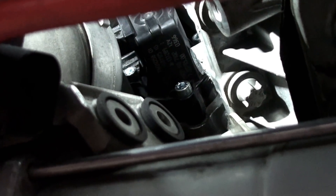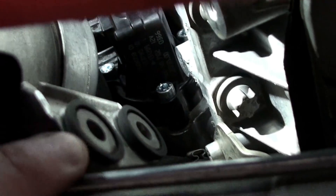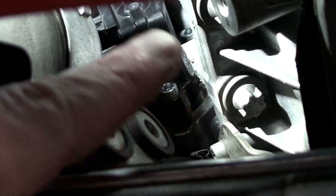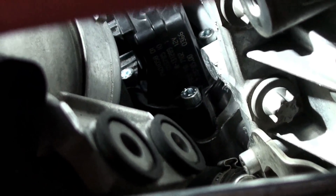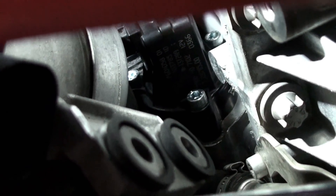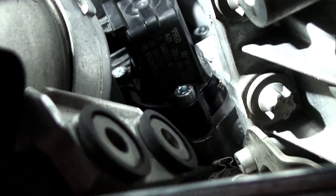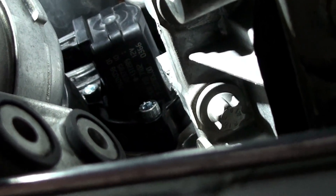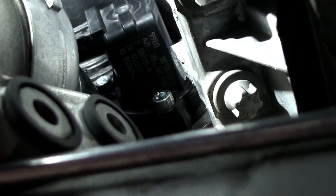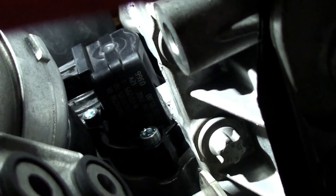The diverter valve is in. It definitely went in much easier with the right tools than the other one came out — reassembly was a lot easier. The water pump is currently sitting out of place; you can see it here and this is where it would mount to its mounting plate. We also removed the mounting plate to give more room to maneuver in that space. So we pulled three bolts from the water pump so it could sag and get out of the way, and then the three bolts from the mounting plate. Everything is now all plugged in and good to go — it's just a matter of putting the mounting plate back on, remounting the water pump, plugging the water pump and diverter valve back in, and then reassembling the belly pan.